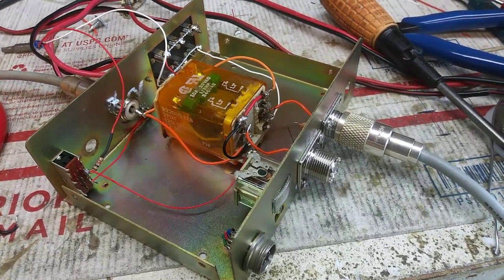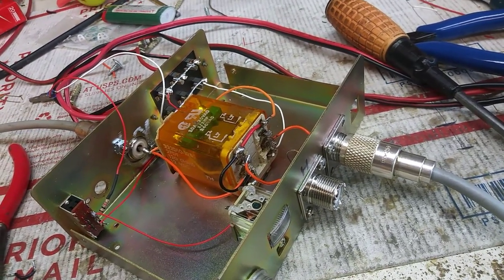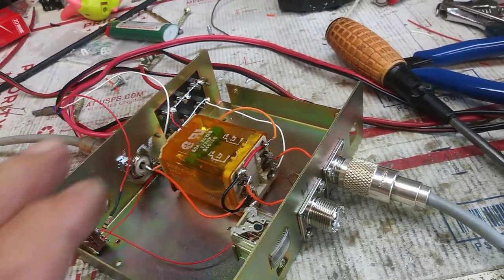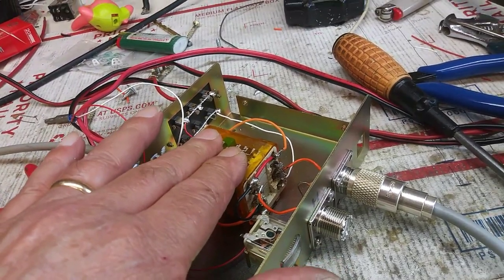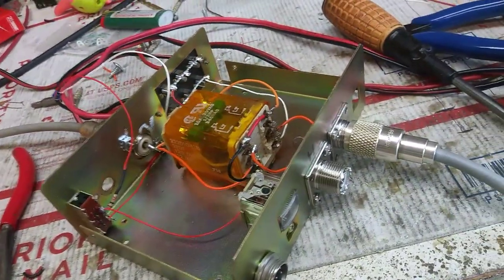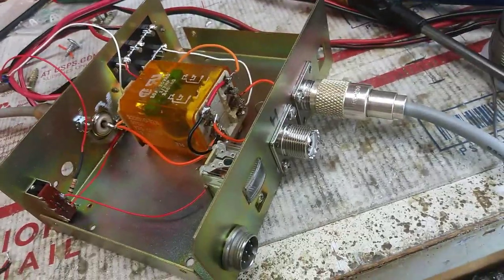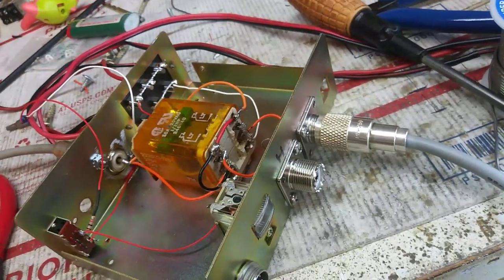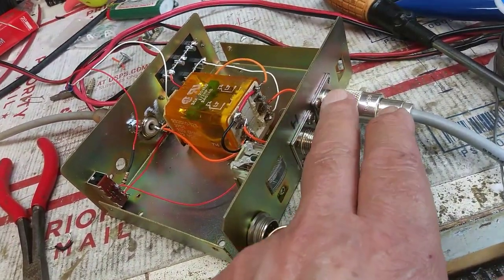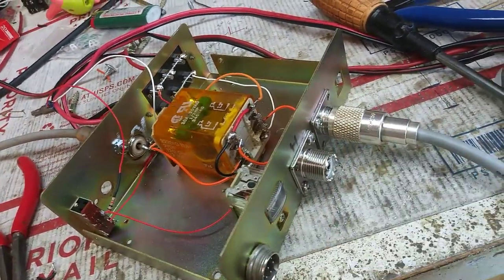When I tapped the relay, it wanted to act a little bit stupid, so I put a 30-amp relay in here using one that I have. Just disregard the other video — I've deleted it. The wiring was incorrect. What I noticed was that no matter which side it was, it was still reading continuity when one side should have been infinity.